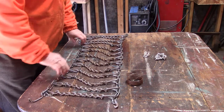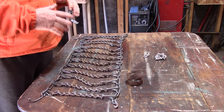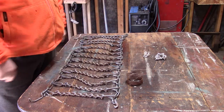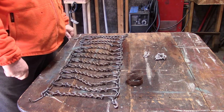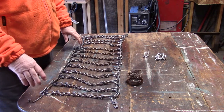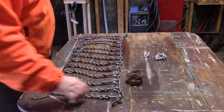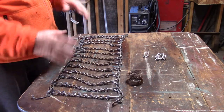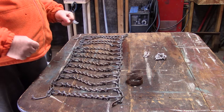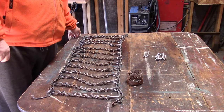I'm a firm believer that your chains shouldn't be singing tight across your tires. They should be a little bit loose so that they can kind of flop around and move in and out of the bar grooves on your tires, so they can get better contact with the ground and the ice and snow when you're driving over. I put the chains on not singing tight, but tight enough so that they don't flop around too much. To keep them from moving from side to side on the tire, I'll put a bungee cord across the hub to keep them located. I use bungee cords because they're cheap.